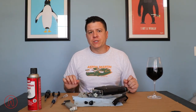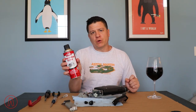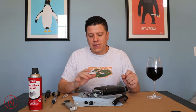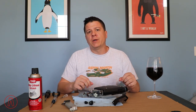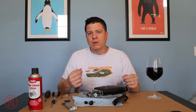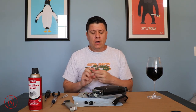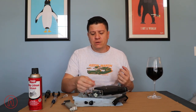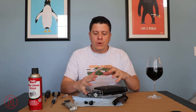The last thing to do before this gets reassembled and put in the car is to lubricate these gears. I have some white lithium grease from my garage — it's not ideal because it's a little heavy and sticky for this application; however, I can get away with it in the hot climate of Florida. If you're not in a hot climate, you'll want something more lightweight — you can find that at a parts store, on Amazon, or at a hobby store. Anything that's just a lightweight lubricant for plastic components is all you need.